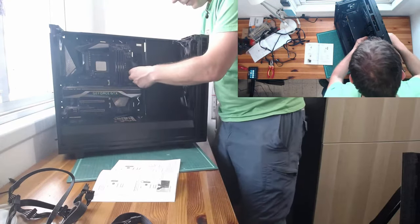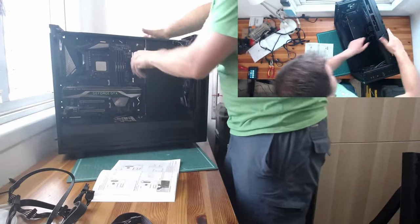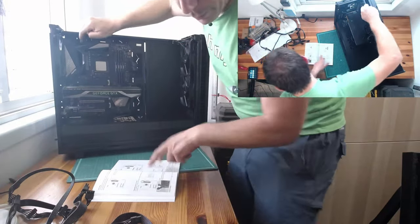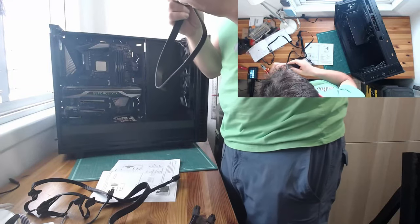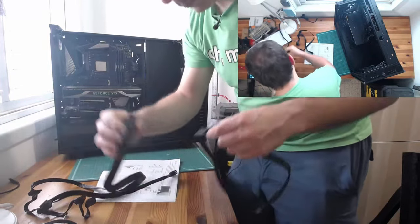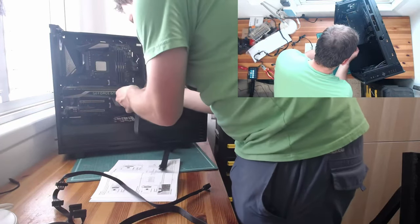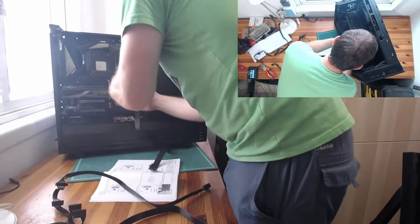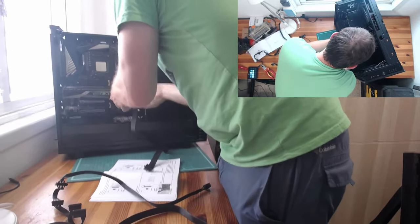Alright, so presumably these 2 fans here will get power once I run it. Okay, so this is hooked. That is what they call the ATX pinout. Now I need the ATX 12 volt, these 2 as well. And are these it? Or are these PCI Express? I think these are it. Oh, this is PCI Express. That will go to the graphics card. Let's do that already now. Click, and third click, please? No? Need to take this one out first.